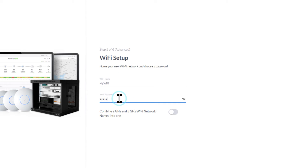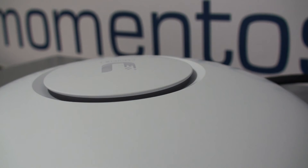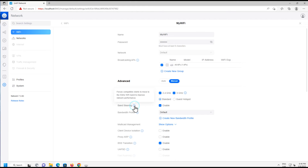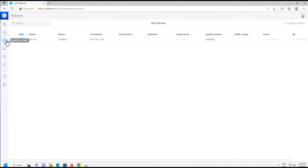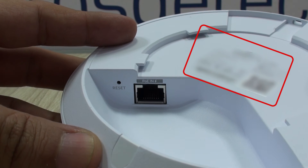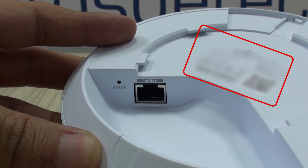Now you are ready to add devices to your network. Connect the device to your network, being very careful to check twice that devices have access to your network and not just the PoE switch — this way they will show up in the dashboard. Another very common problem for not having them appear is that the firewall blocks the network application, so make sure it has the proper exemptions active; you can temporarily disable the firewall if you're experiencing that inconvenience. Adopting the device will provision the information associated to the Wi-Fi network you configured in the controller. You may adopt 1, 10, or 100 devices and it'll take roughly the same time for them to be deployed. It is a good idea for big deployments to take pictures of each device's serial number and QR code, just in case installations won't let you have physical access to them. Also learn how to remotely proceed with a factory reset.